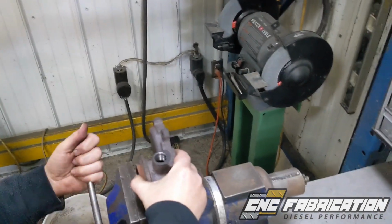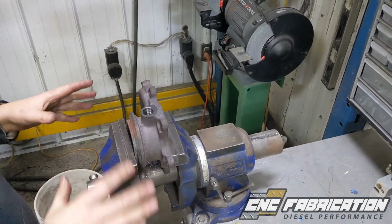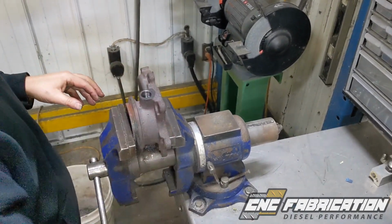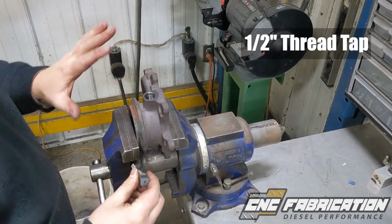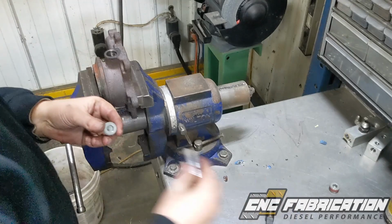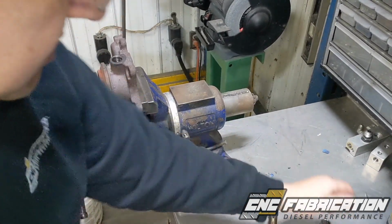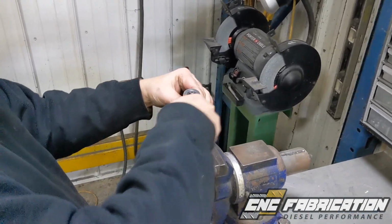And what's really, really nice about this is you don't have to drill or oversize the holes. Once you punch out these bushings that are in here, it is perfect already for a 1/2 inch pipe tap. So I've already threaded this side, and so I'll go ahead and install another cap. I've had these caps laying around from miscellaneous stuff that I bought over the years, and I just kind of keep the stuff.